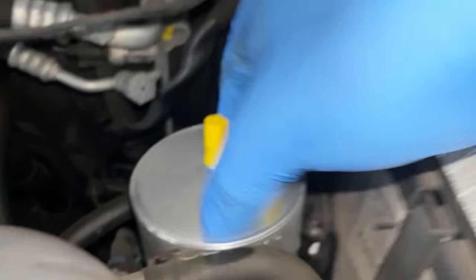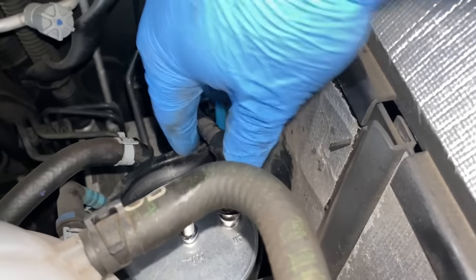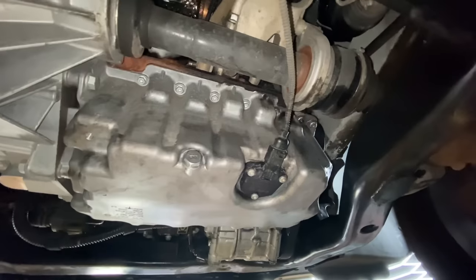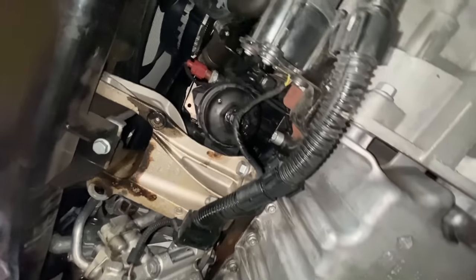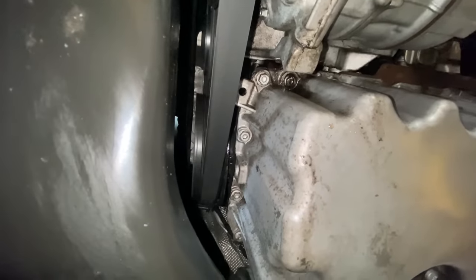Once the filter is in place, it's good to use diagnostic or put some fuel into the new fuel filter, otherwise you might end up with an airlock in the fuel system. So just the last quick check of what we actually did. We put a new sump plug as well, 25 newton meters, new oil filter, 25 newton meters for the housing. No oil leaks, everything's cool, running.